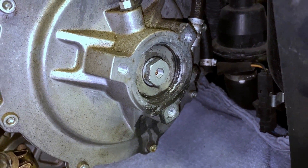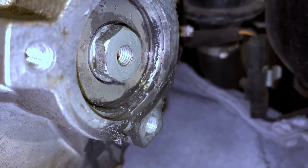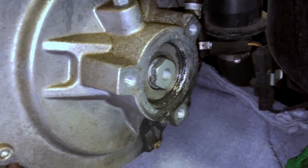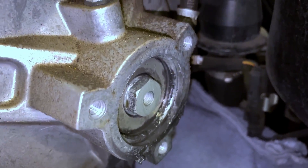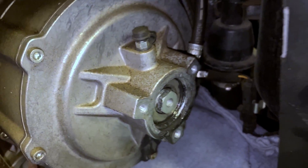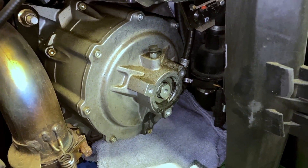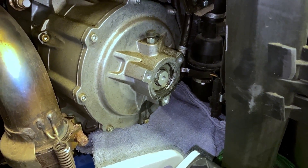My concern is what does the bore of that piston look like — it almost looks like something's been beating on it. See the etching down at the bottom of that thing. It seems like you could remove it — you can see it's a separate piece. I don't know, the whole thing is pretty weird. She needs to be pulled apart to see where she's at. There was enough oil down there that I'm sure the owner has filled that reservoir up a few times. Pretty crazy.